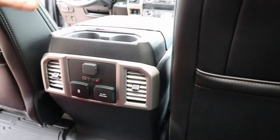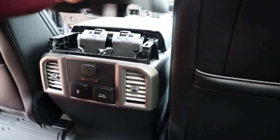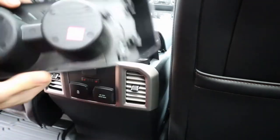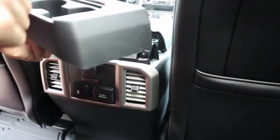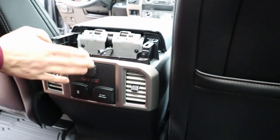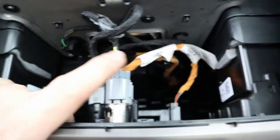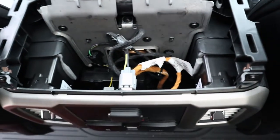Okay, so we're in the back seat. We're going to start with getting the console pulled. These are super easy if you've ever done them — you just push in on the back and lift. Cup holders popped right out. On my '17 there were actually rubbers in here, but they got rid of that. Now the plan is you have a 12-volt plug here. There's power and a ground wire. We are going to tie into these to get power for the phone booster and our radio. We're going to run off this because that's fused.